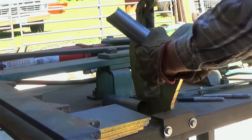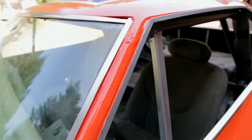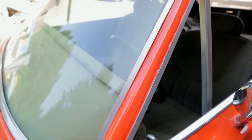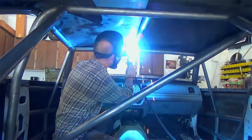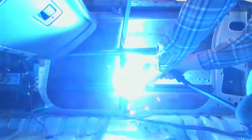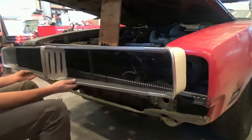Normally you take a car and put a roll cage inside it, but this is kind of half and half. The A-pillar is 4130 thick-wall tubing that is the A-pillar but also the roll cage. So I was able to use a real Charger windshield inside the Charger frame, because it fits the Auto Metal Direct roof and the Auto Metal Direct cowl. The A-pillars are fabricated with the roll cage integrated. There were a lot of things that worked better than I expected, and it came together quickly — going from a running Crown Vic to a Charger shell in three days, running and driving as a Charger.